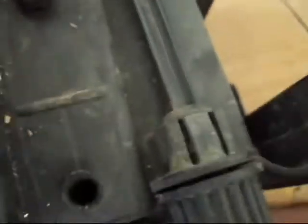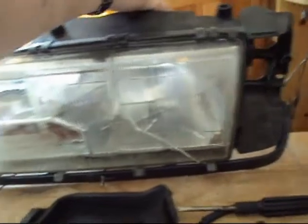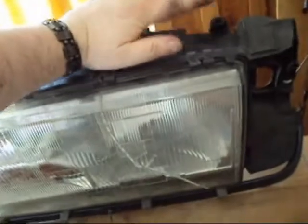There you go — oh, look, those are the adjusters for doing the height of your light. Just turns at the back there for the little cogs. This one's very long. Twist. Always give that a spray with WD-40 if you're going to adjust your main headlight up and down. Remember, this is the front — that's where the indicator would be — so those knobs are on the top, where the bonnet would be.